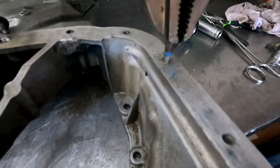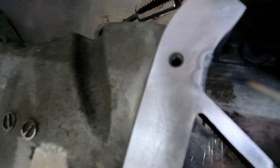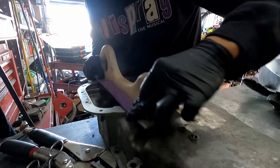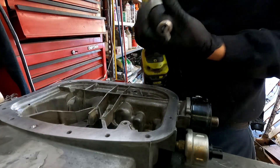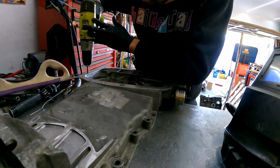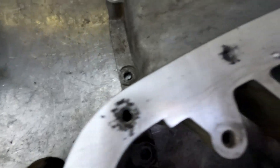Pulling out the stud. Created a high spot here from the weld folding over. I found my 6x1 tap — don't use any power tools, this is using it incorrectly. Finish tapping it, then I got all that.